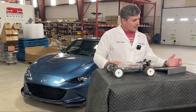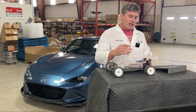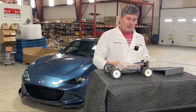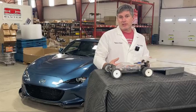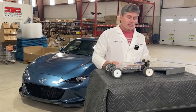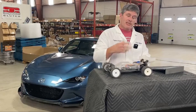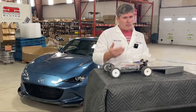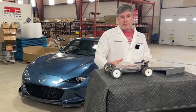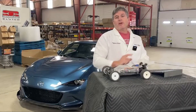We had questions about suspension geometry and aftermarket control arm parts. Because KPC relies on the anti-squat geometry built into the ND Miata, if you mess with the control arm pickup points, it may actually have the opposite effect. If you build negative anti-squat into the suspension, you may actually increase the roll. Aftermarket control arms should not make a difference, but if you start changing subframes, be aware — messing with suspension geometry creates one more pitfall.